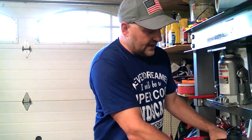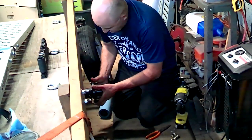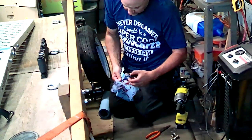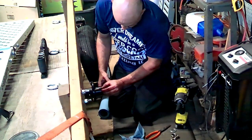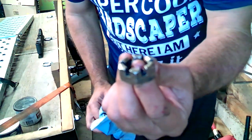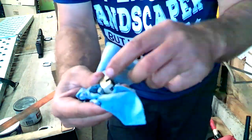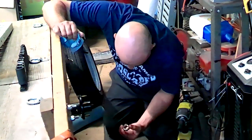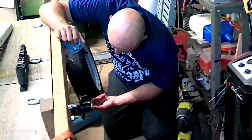I'm back here with the hub. We got the bearing in there and we hit it over. Now there's a concave element in this particular trailer that the bearing goes inside. Then we use this crown nut — it's called a crown nut because it kind of looks like a crown. This part goes on the outside and this part goes on the inside, actually holding the bearing. The most difficult part where a lot of people get thrown off is putting this nut on — they try to crank it down tight, but then your bearings aren't going to move.